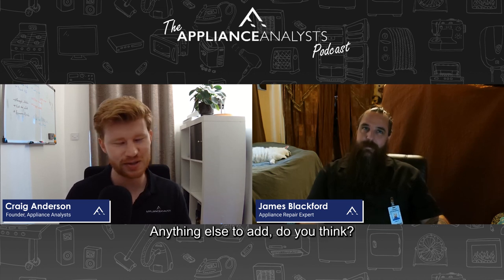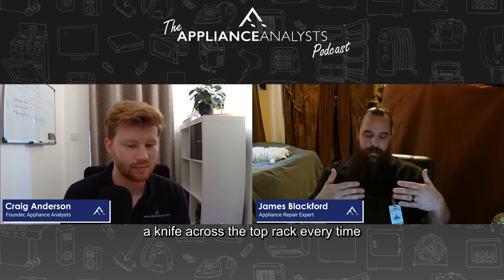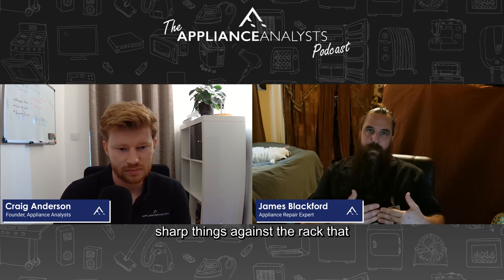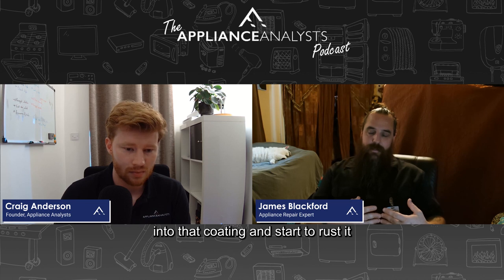Anything else to add, do you think? Let's see. Any other issues? One thing is with large knives, sometimes they're too big to put in the silverware rack, so a lot of folks will lay them across the rack. Just be mindful when you're laying a knife across the top rack. Every time you put it against there, especially if your rack is coated, it'll cut away at the coating and could prematurely start to rust the rack. So be mindful when you're putting sharp things against the rack that you're doing it in a way that it's not going to cut into that coating and rust it out.